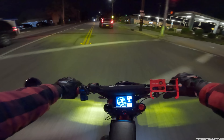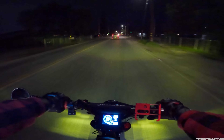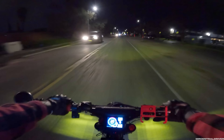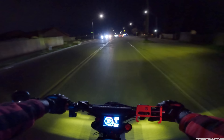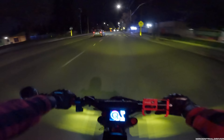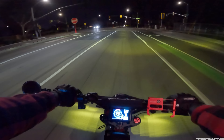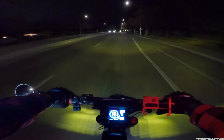I just noticed on this bike that I put regen braking on, so every time I let off the throttle it slows down instead of coasting — I think I set it at 10 or 15 amps. It's nice but I'm not sure it's worth it without hills around here, since I'd have to get back on the throttle approaching a light anyway. The Cycle Analyst on the Zeus is a cool but old-looking display — I really wanted to use the same display controller as this Super 73 on the Zeus but it was just too much work to wire up.